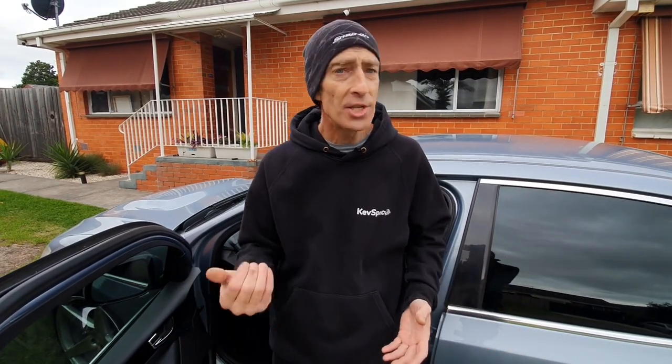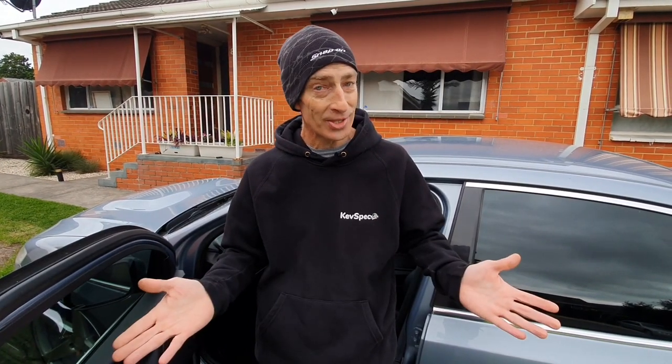In this model in particular - but this can be a problem on any car - if your kids open the glovebox on a Mazda or whatever, and you leave the glovebox down and lock the car, it will leave the glovebox light on. In the morning you'll have no battery because the glovebox light's been on all night. FG Falcons especially have this issue with the glovebox left-hand side warping, so the little switch that contacts the light doesn't make contact and the glovebox light stays on.